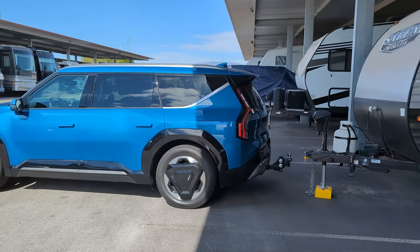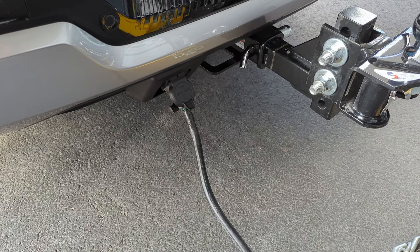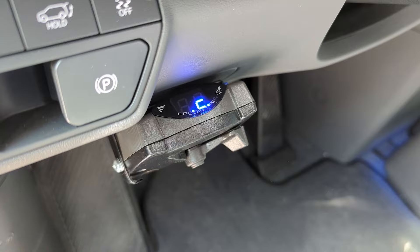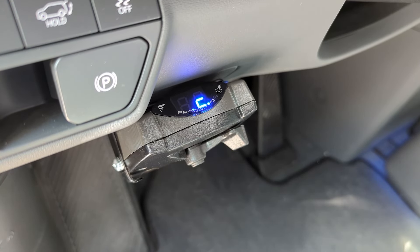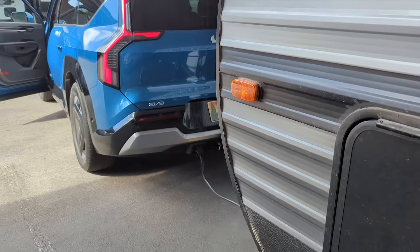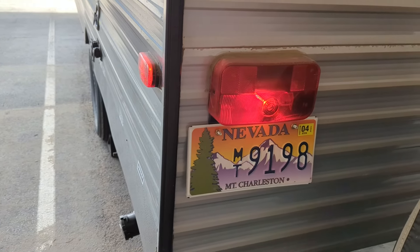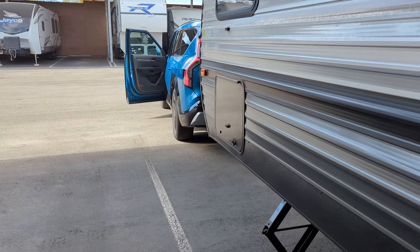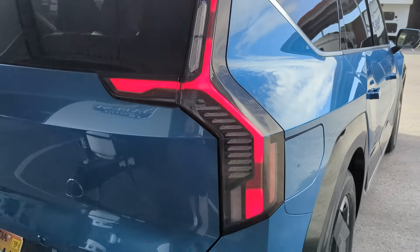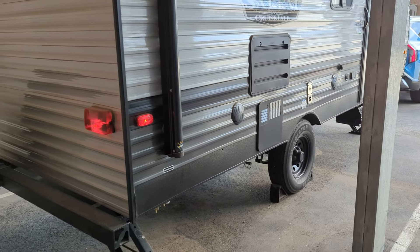Now it's time to test it out. This is our trailer at the storage place — 23 feet, ultra lightweight, single axle. We've had it for a few years and used it with our Jeep Cherokee. Turning on the car, the brake controller displayed 'C' which means it is connected to a trailer, and depressing the brake it shows the amount of braking force being applied. Lights are on on the car and also on the trailer. Turning on the left turn signal, the left one is flashing at the back and the right one is solid. Checked the right signal — flashing at the back too. Everything is working.